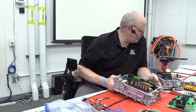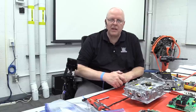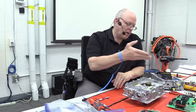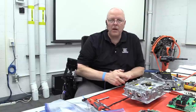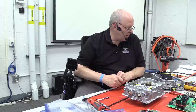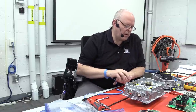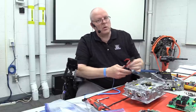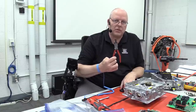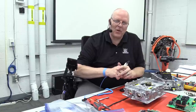This inverter converter is from a 2017 Prius Eco with the 207.2-volt lithium ion battery. A Prius with the nickel metal hydride battery would have a very similar inverter converter but likely different part numbers for the motor generator control computer, due to differences in how nickel metal hydride versus lithium ion batteries are charged. In summary, the DC to DC converter is fully serviceable, and the motor generator control computer is fully serviceable — just be sure to use the special pliers for the vibration dampening connectors rather than a pick or screwdriver. Now all I have to do is put it back together and put it back in the car. Thank you for watching.